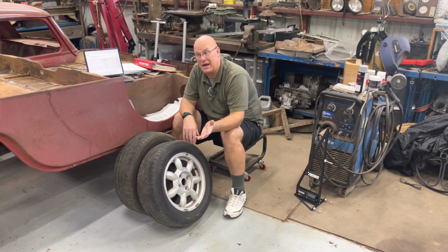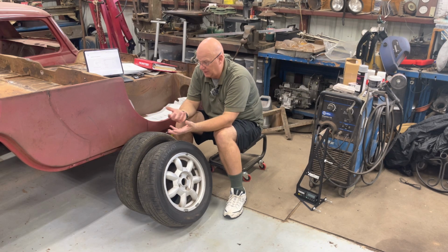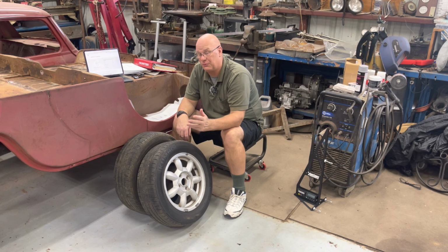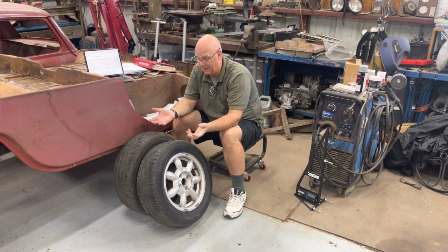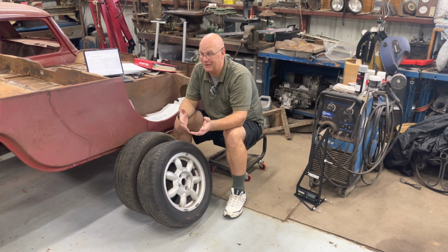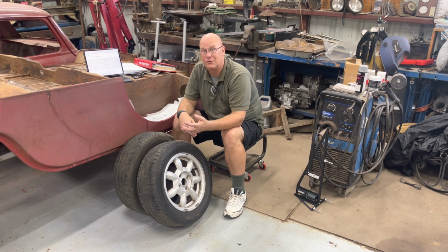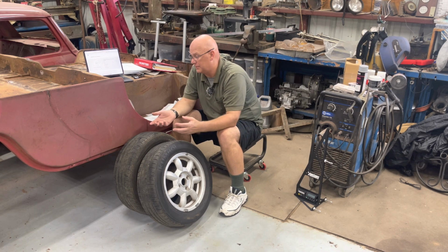Some Volkswagens and some Audis, there's actually a special machine or an adapter you have to put on the bottom of the cross on the Hunter lift that actually pulls the car down a certain distance. That's why on certain Volkswagens and certain Audis, you can only get it aligned at the dealer. Because last I heard, every dealership had to pay a bunch of money for that special rig to do the alignment. And they had to call Audi of North America every night saying, yep, it's locked up. Apparently some dealers didn't call to say it was locked up and no one else could use it. And they got it taken away from them. So Audi's going to cost you a bunch for alignments. Just because of that one little machine, or a little adapter for the Hunter machine.